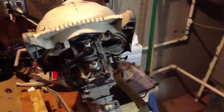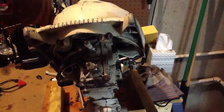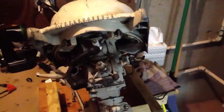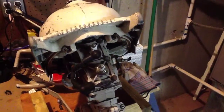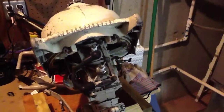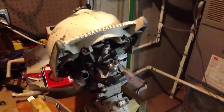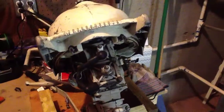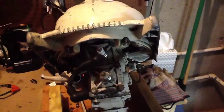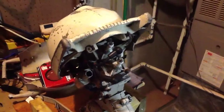What I'm going to do is probably tear the head off of this and check it out. Maybe I just need a new gasket. It could be that those pistons and the rings are all gummed up — that's what I'm hoping anyway. I'm going to give them a good cleaning and see if that doesn't help. If these things go bad, there's not a whole lot you can do other than replace the power head on these things.